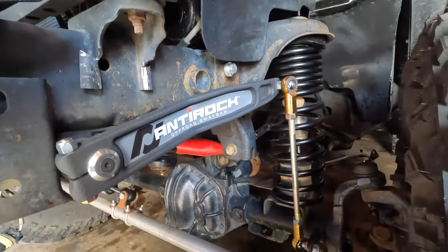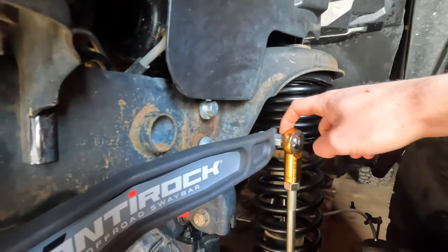Driving this on the road - really not bad. I think it's well worth the compromise to not have to get out in the dirt and unhook your quick disconnects. Another thing too is this is not just about avoiding the disconnect. When you're articulating off-road and flexing out without the sway bar connected, the tire that's barely on the ground isn't getting any downward pressure, so it's not getting the bite that it should. With the Antirock sway bar, it's applying downward pressure so you're getting a lot of bite from that wheel that's barely on the ground. That's another huge advantage of running the Antirock, and I'm super excited to test this out at the Badlands this weekend.